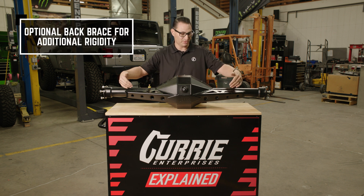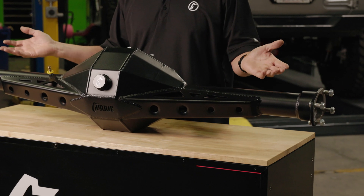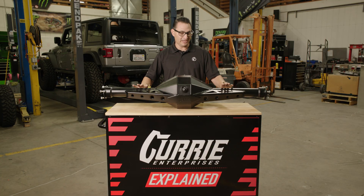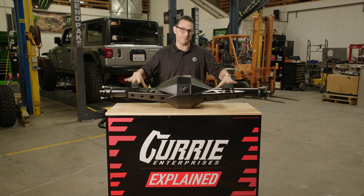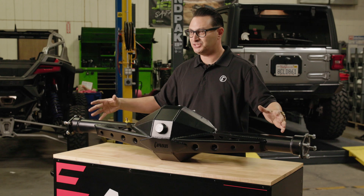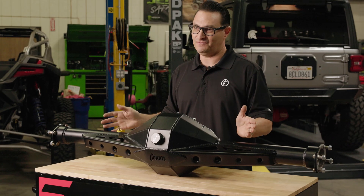This is also equipped with our lightened back brace, which is going to add rigidity to the housing. Where does that come into play? Basically, if you're hanging the front wheels off the ground and you're twisting up your chassis, if you make that kind of traction and power and your four-link is welded to the tube, this thing wants to twist. That's when you're going to necessitate a back brace. If the housing sees any kind of twisting motion because the chassis is going to be twisting up a lot, the back brace is going to help this not move. What we're trying to do is prevent things from twisting or making movement. If the housing, the third member, and the axle shafts are all twisting, that's when things break — and we're trying to prevent any kind of failures.